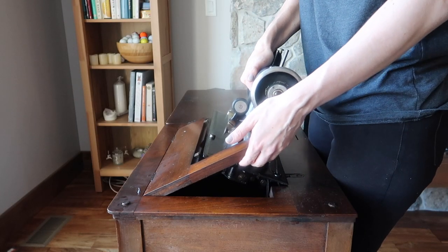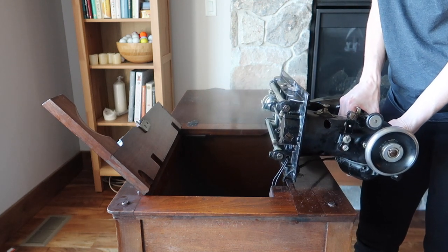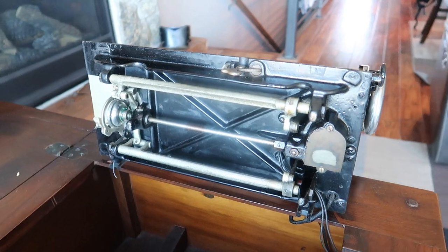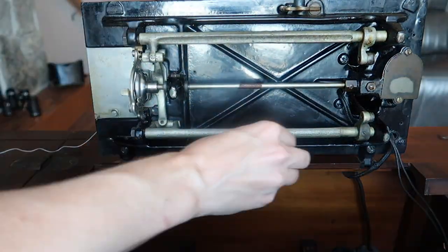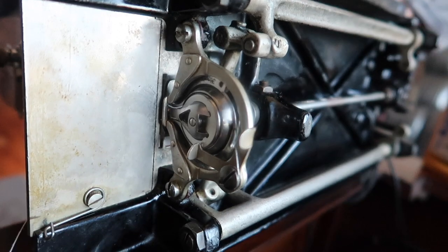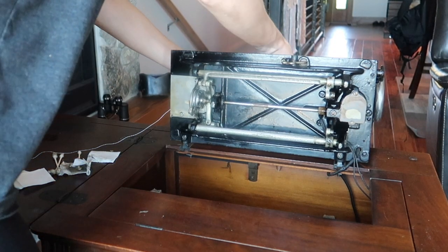After reassembling the back end of the sewing machine once I was done with the cleaning and oiling, it was time to turn my attention to the bottom of the sewing machine. This is something that I didn't realize you had to really focus on, but it was mentioned in the original manual with a few oiling points, so I did take the time to clean that as well. I found that there was actually quite a bit of thread wound around the bobbin end - some beautiful green thread - so who knows, maybe I pulled off a 90-year-old piece of thread. I made sure the bottom moving parts were all as clean as I could get them, then oiled all the pieces thoroughly - I definitely over-oiled it for a regular oiling, but I really wanted to make sure the oil got into all the crevices to make everything run as smooth as possible.